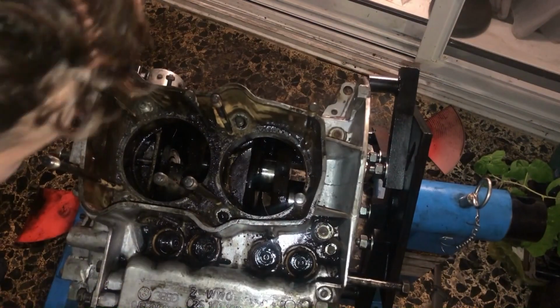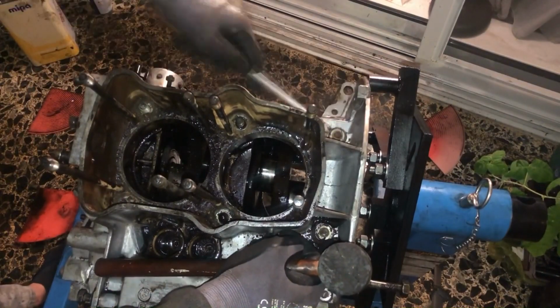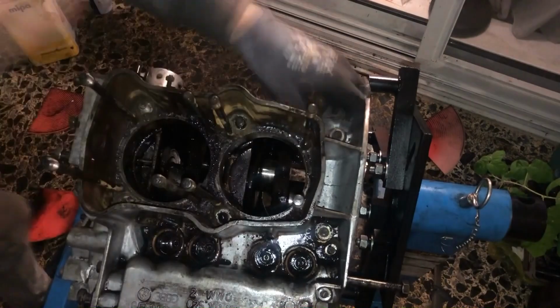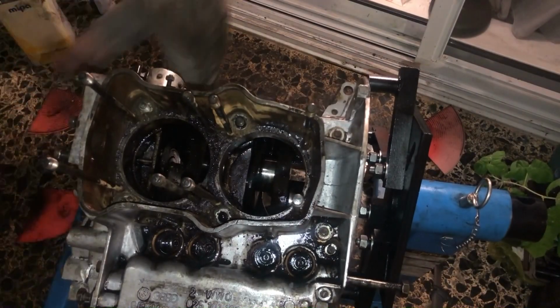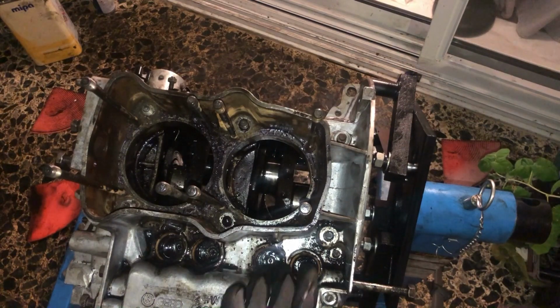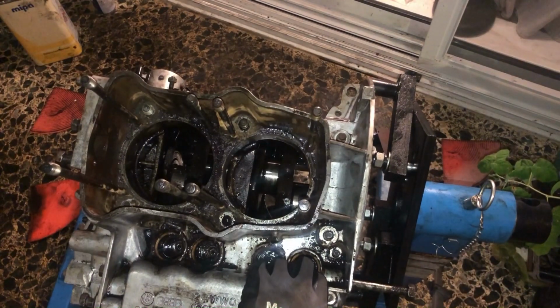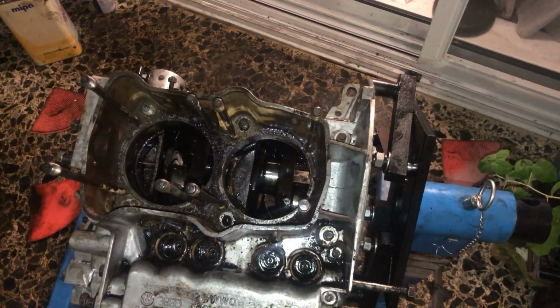So now you got your screwdriver and pry it through locations. You get your screwdriver and put it through the 2 prongs where the red part is, which doesn't damage any sealing surfaces, but it helps you break the seal up or break them loose, and you wiggle them back and forth in order to remove the case halves.